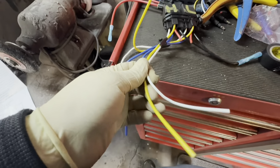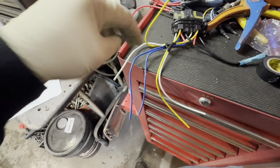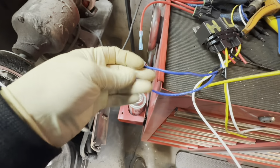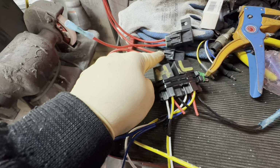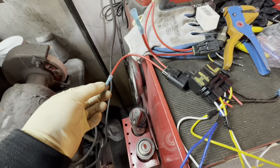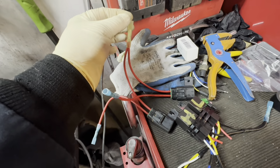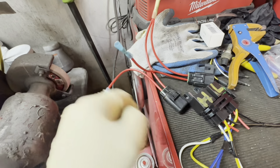Same thing, the next switch, I have the switch separately for high beam. I'm gonna do that. The blue wires were battery constant. So we're gonna take those and we're gonna put them into here and here. So basically each relay is gonna have its own fuse here, and this inline fuse. So they're separate on the sides that feed. This will feed the relay. This will feed the relay. Over here, where they get power, this side they can merge together and go directly to the battery. You don't want to merge these sides here, because if it backfeeds, it'll backfeed into the other one as well.